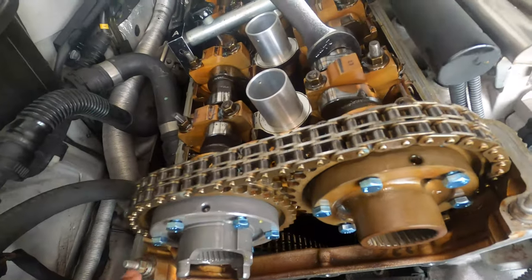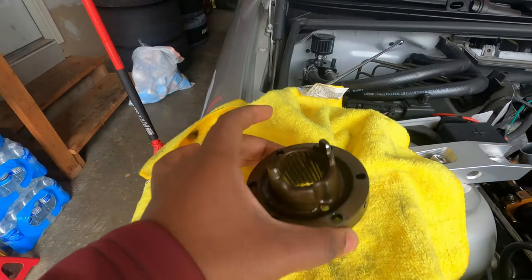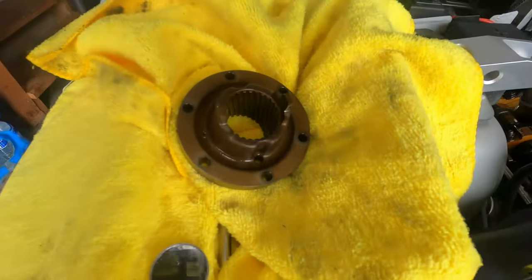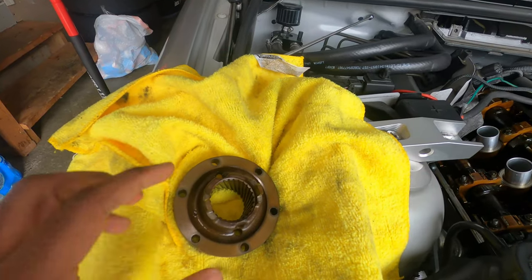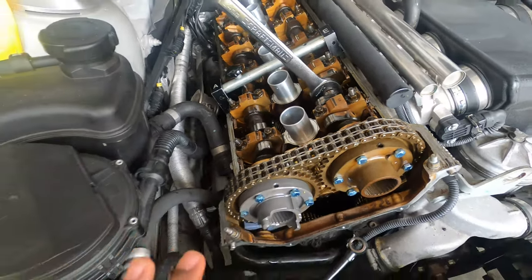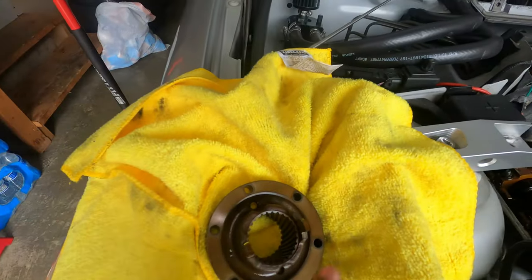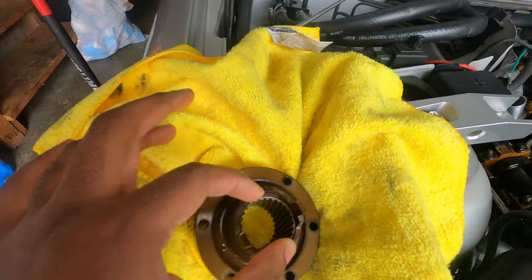We have new bolts here and we're going to torque them soon. You can resell the old part if you want — I probably will. One thing to mention: if you want to use the factory hub, it is recommended to use the basin oil pump disc because that fits with smaller holes, compared to the VAC which has bigger tabs where you can use a factory oil pump disc. So those are the two options: either go with VAC and keep your factory oil pump disc, or go with the basin disc. The basin disc is a different, sturdier material if you want to ensure your tabs aren't broken.